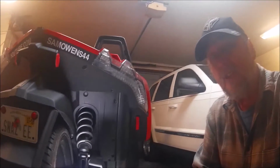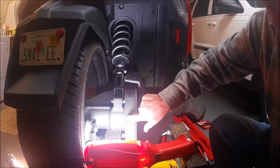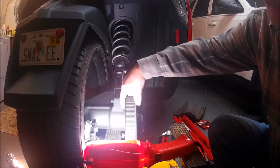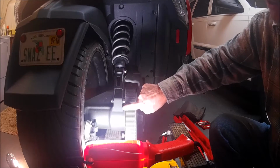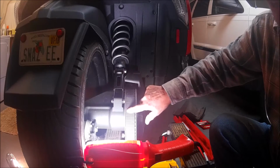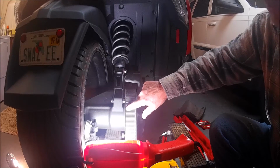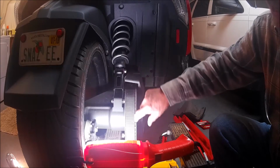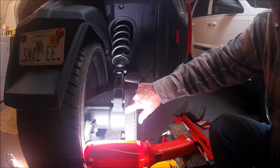So let's focus on the area that we're looking at right there. We're looking at this area right in here with respect to the inside of your pulley. This belt should ride close to this inboard edge, but without touching it. If it's over and touching, it's going to make a squeal, so you don't want that. You want to be able to see some teeth like you see over on this side. You want to see the pulley teeth on the left-hand inboard side.